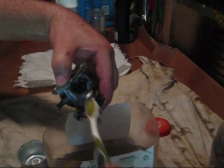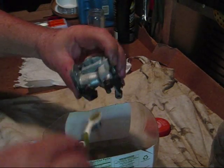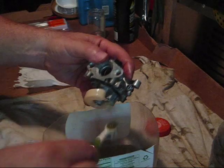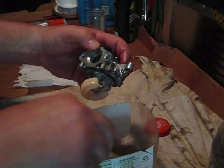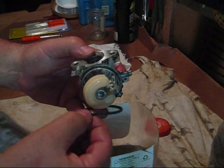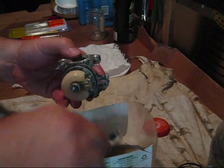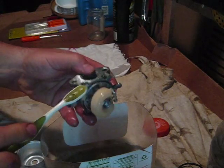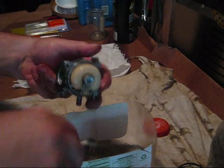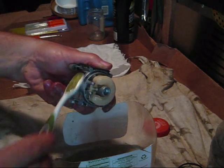As I mentioned earlier, you can see on this carburetor it's a newer model — it doesn't have the gas adjustments. The gas that I'm using is gas that I generally pull out of machines that have been sitting a while, and I will be using carb cleaner. When you use carb cleaner you do want to take this ring off before you spray it with the carb cleaner — I've seen these rings expand where you couldn't use them. That one's in pretty decent shape so I'll be using the same one again, unless I find a crack on it in further inspection. There's going to be quite a bit of build-up around the ring.